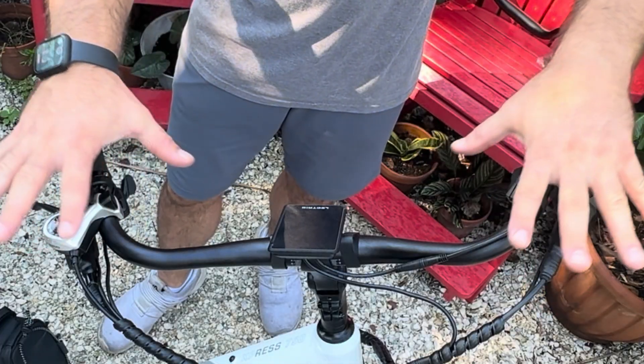The shifter has a screw right here on the bottom, so you'll want to acknowledge that. I like to use the flathead because it's less prone to strip, but it's a little more difficult to drive it off, so keep that in mind. I'm taking everything off as a package so I can keep the wraps on there. Then you have these two screws — remember to back them up because the nut will fall out when you're taking this off, so make sure you don't lose that, especially if you work in a shell like me.